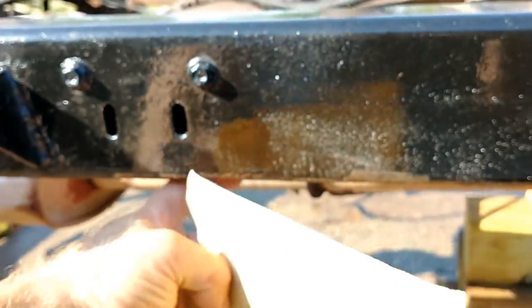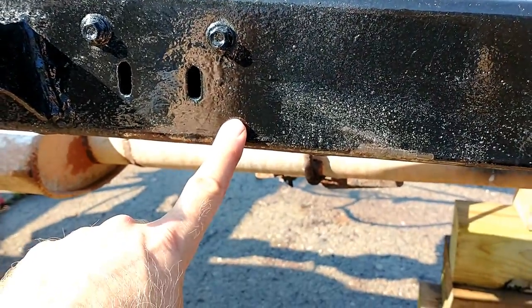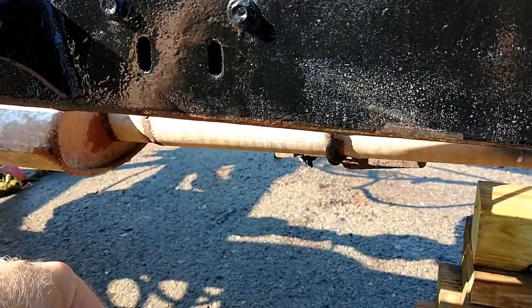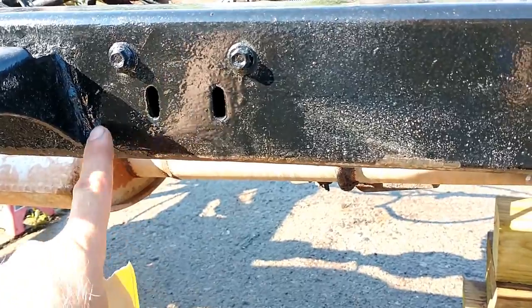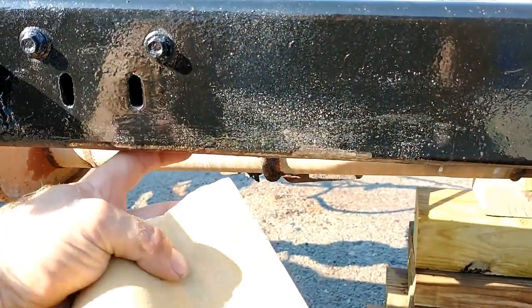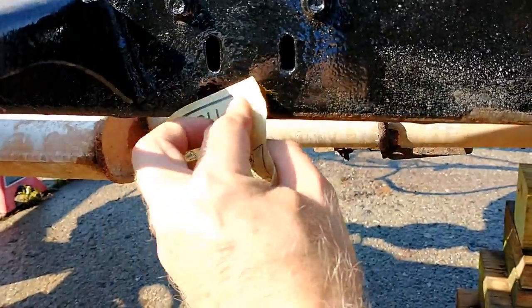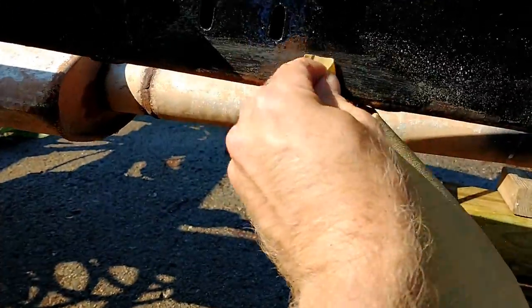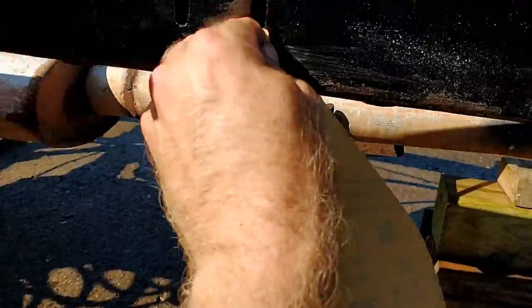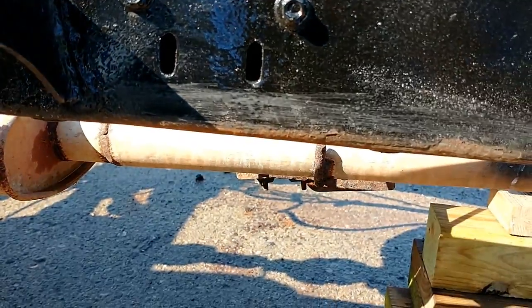But where I was not able to finish it, I'm going to have to get a good seam here. And because of the gloss, the paint won't actually stick to that well. So I've got here some 120 grit sandpaper. I could probably use something a little finer than that, but really I just want to take some of the sheen off so that the overlap will stick and it's not just peeling right back off. So let's give that a start.